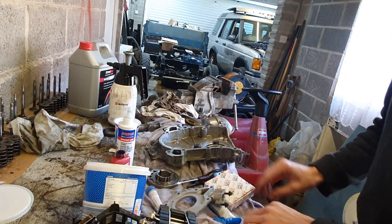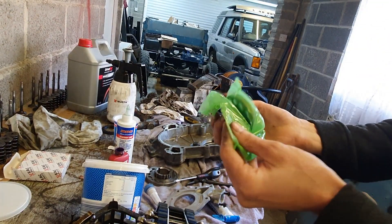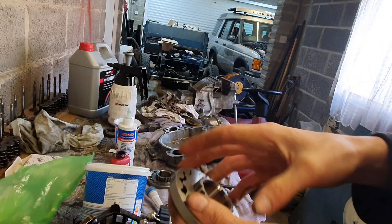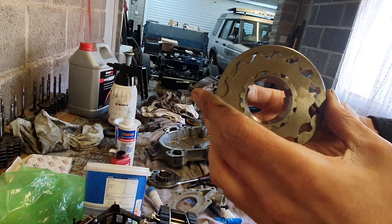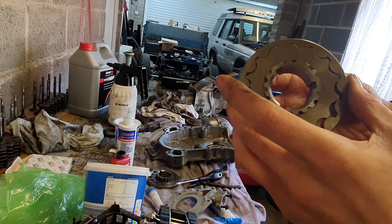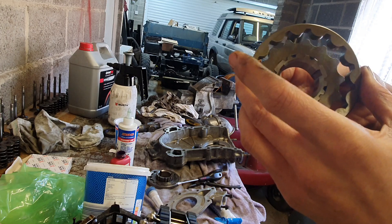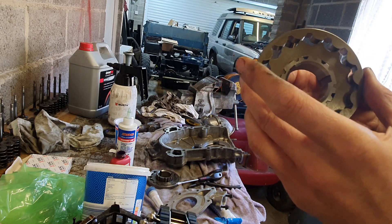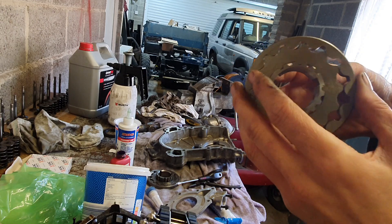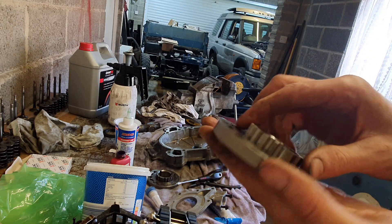So that's the old one, and here's the new one, which is milled from solid steel and it's from Turner Engineering. It looks very nice — looks exactly the same. It rotates nice and freely through its rotation, so obviously there's no wear on those lobes and on those contact points on the inside. No scoring on it, and it'll be a fraction taller as well because of the wear on the old one.